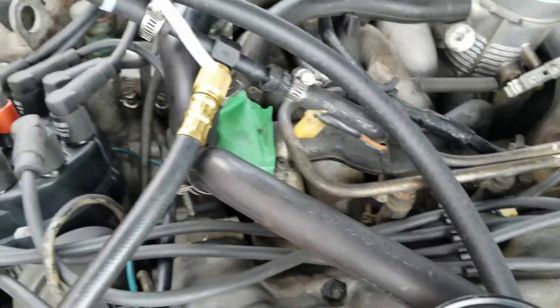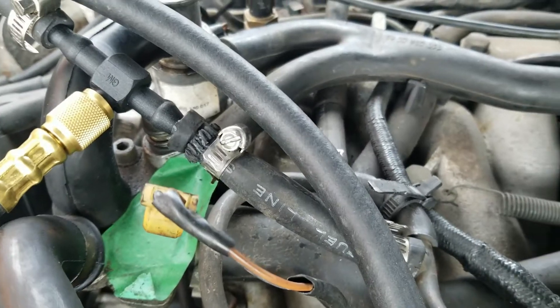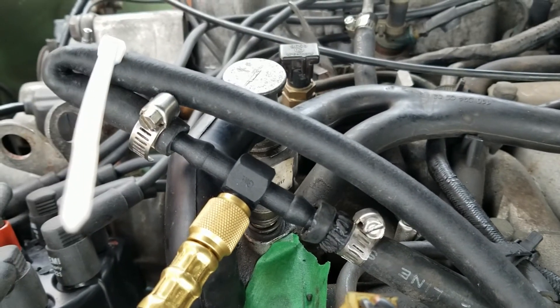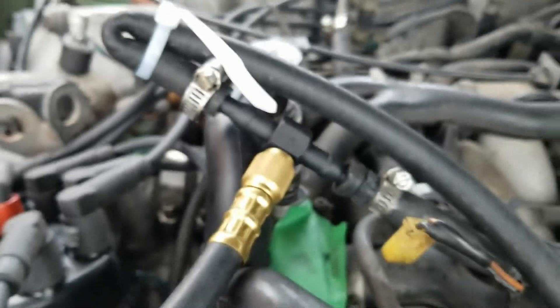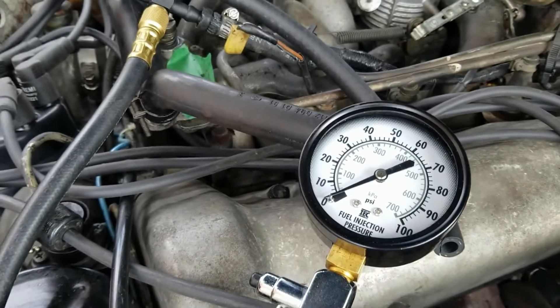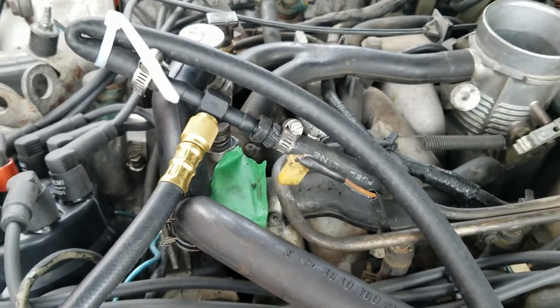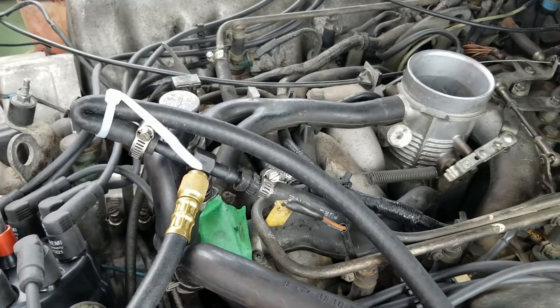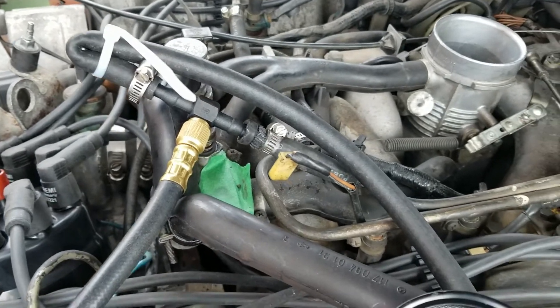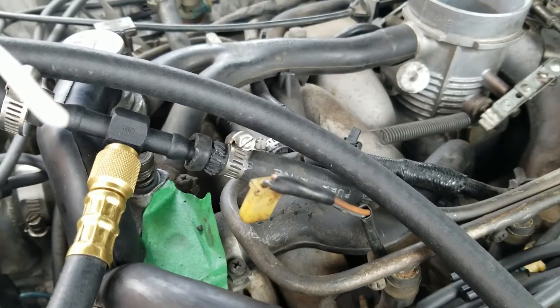As you can see, I got that gauge hooked up in place of the cold start valve here on the fuel rail. All those hoses will be replaced — after examining them, I wouldn't use them, so I'll definitely suggest the owner buys them all new. The fuel gauge is hooked up with a regular fuel injection gauge in place of the cold start valve, which kills two birds with one stone — we're preventing extra fuel from going into the intake, and I lost about half of the black smoke coming out of the rear pipes because of that.